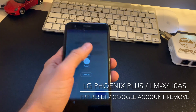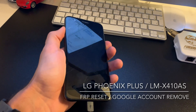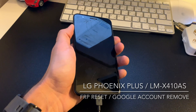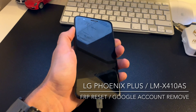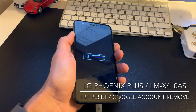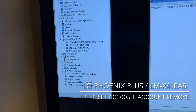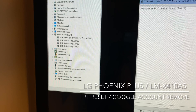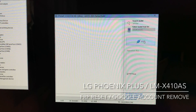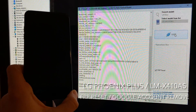Now let's put the device in the firmware update mode. We do this by powering it off, then keep pressing the volume up while having the USB cable inserted. If everything is okay, the phone enters the firmware update mode, and also in the device manager we have here LG USB serial port. Now let's simply press connect — the phone should get detected and the work starts.